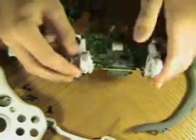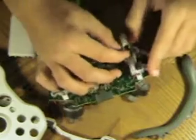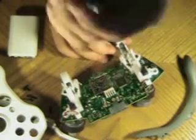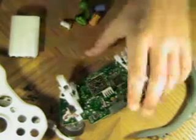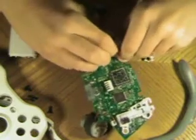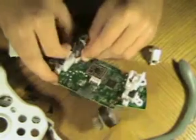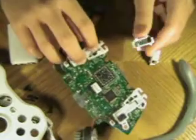With this one, there's a plastic part right there — you have to push on both of them and then just push the Xbox trigger forward and it should pop out like that. Now be careful taking this off because there's a spring in there that can easily fly across the room. So once again, you push this that way, then push the trigger that way. It'll pop down. Then you push on the two plastic tabs and wiggle it off.